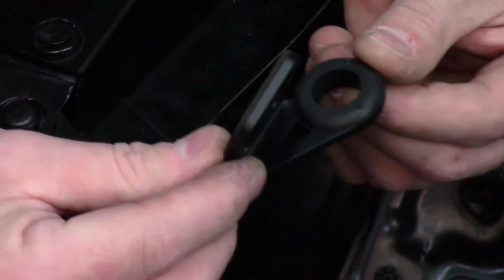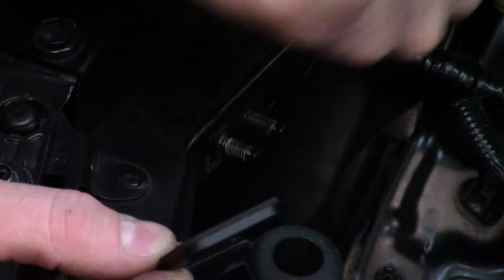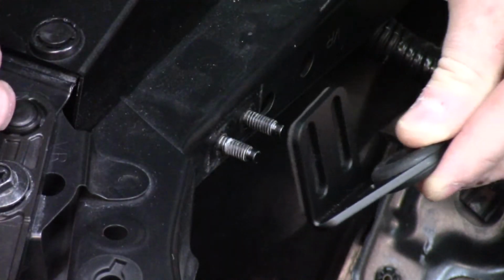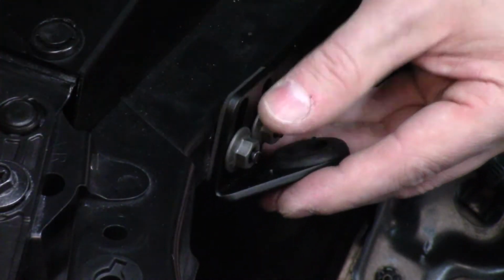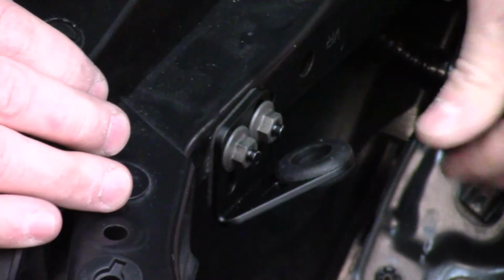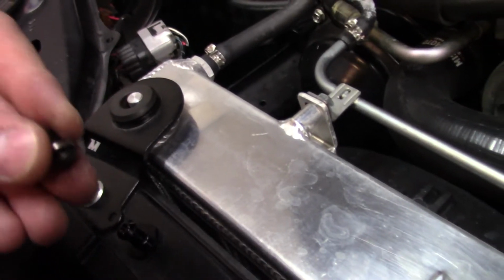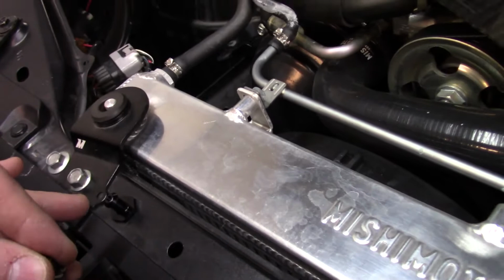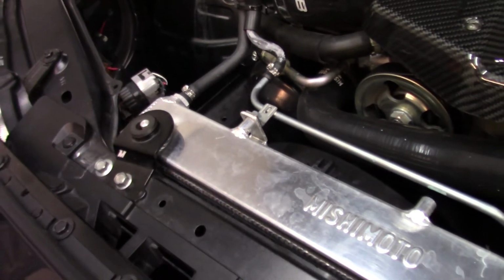The next piece we're going to install is this tiny little bracket with a grommet and the foam piece. This only goes on one way. In order for it to go on, this rubber grommet needs to be pointing towards the back of the car itself. It's going to seem like it's at a weird angle, but it's going to be holding it from the top. As you see how I'm inserting it onto the factory stud posts, we're going to use the factory provided nuts that they give us because they're nice and black instead of silver. And we're going to run those down. We're not going to tighten these up because, just like the other bracket down there, these will be snugged up after we get the intake installed, because everything needs to be lined up. But that's how this is going to sit. This little insert sits on top, and then a small screw with a lock washer goes up underneath. You're going to cinch this down, and the intake basically just snaps into those rubber grommets. Pretty easy piece, but getting to it is going to be kind of a pain.